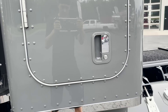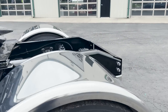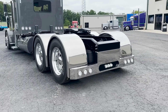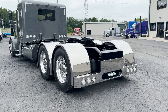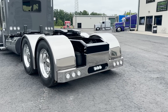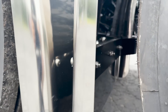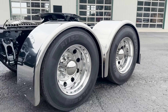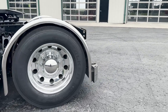We also painted the door handles to match, and painted the chassis just a regular straight black. Then fenders — these are Hogue built half fenders. We didn't dump the air in it, so that's the fenders at ride height right now. Once it's dumped they get really tight. 12-gauge made us this T-bar — super heavy-duty — and we blind-mounted the fenders. You can see our blind-mount brackets; they just bolt straight through, gives it a good clean look. And they bolt straight through the T-bar.